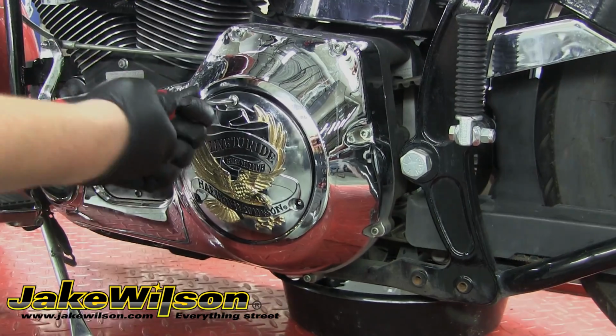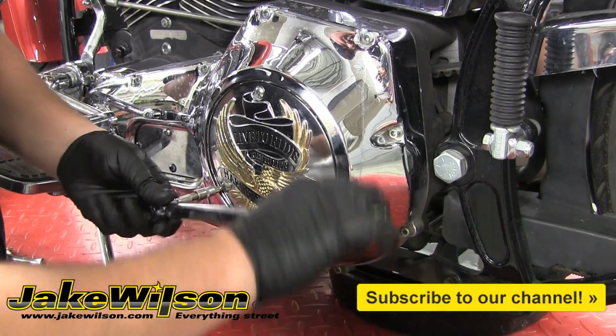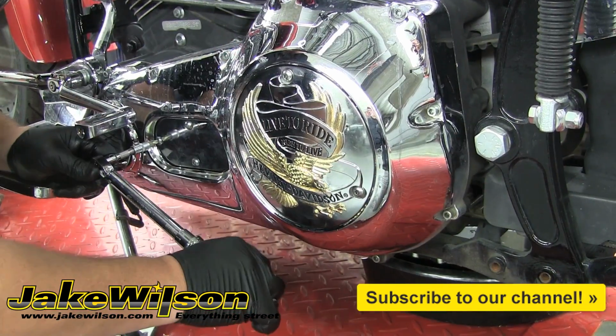Once you have all those bolts in place, you need to torque them down. Our manual calls for 84 to 120 inch-pounds, so we're going to go ahead and torque each of these to 95 inch-pounds, and then we're done.